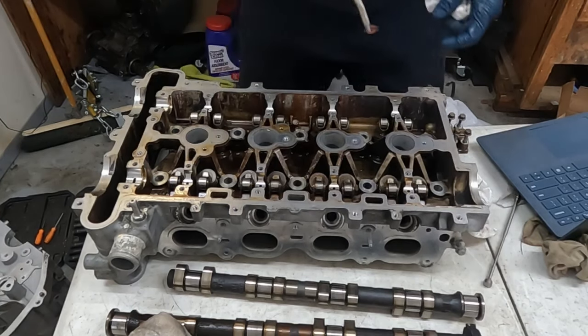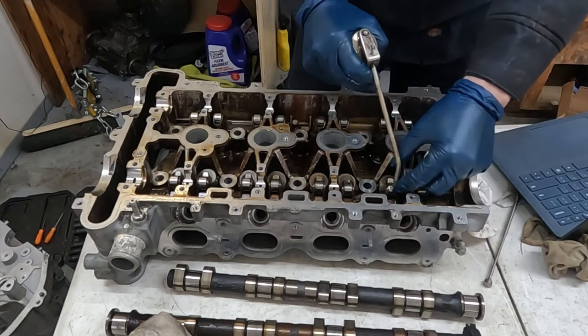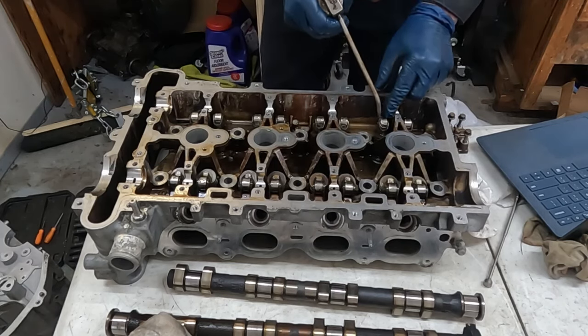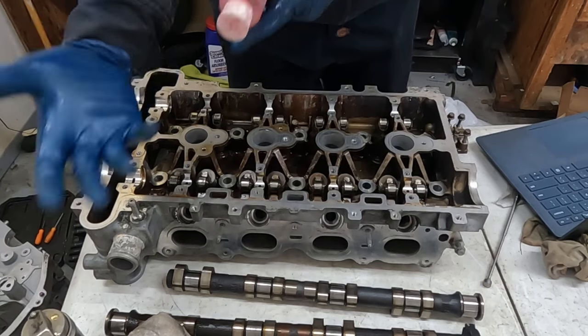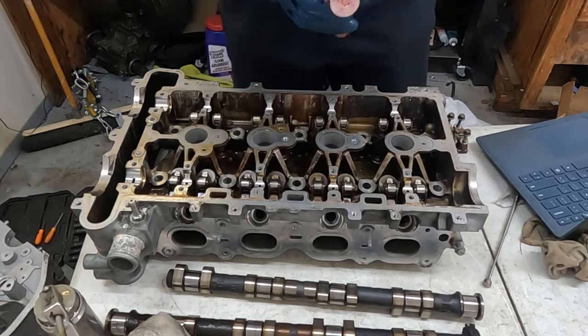Once all our rockers are in, we'll go ahead and just put a little oil on top of our drum rollers. Maybe squirt some in the bearings a little. You can even soak these overnight if you wanted, but this should be good enough. All right, good. Now putting the cams on, you can use this assembly lube, that's what I'm gonna use, or continue using just your oil here. Again, that's gear oil, so it is a little thicker than regular oil, which should be plenty.